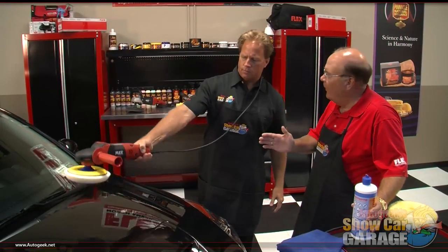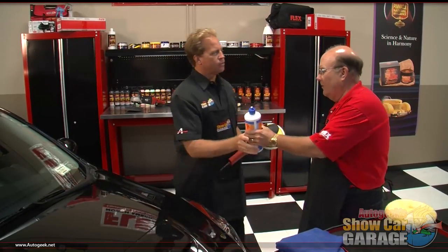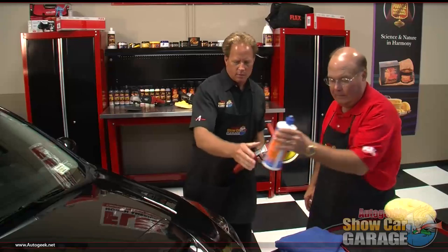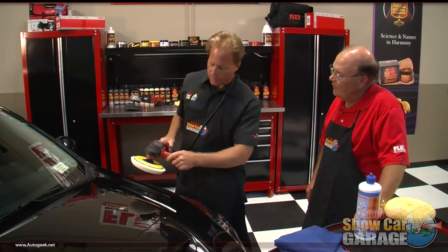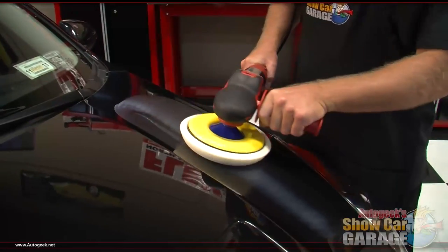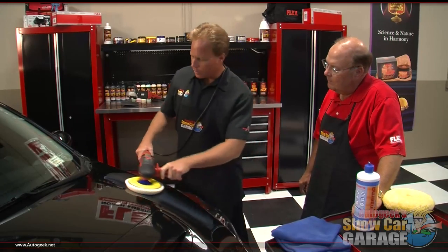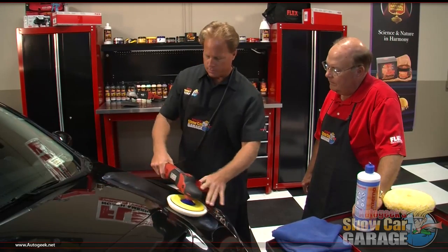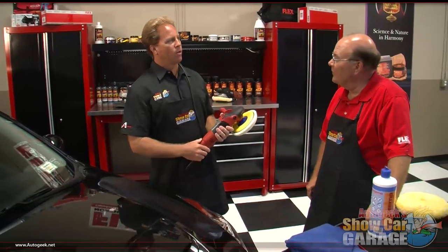Very powerful — this is a professional polisher. Just because the weight isn't there doesn't mean it's not professional. I'm going to lay down a little strip of product here using a technique called picking up your bead at 10. That's 1,200 RPM — it's not even that noisy. The first thing I notice is when I push down on this, the motor does not bog down. That's important to me. It's real balanced and incredibly easy to control. And very, very quiet — how often can you talk over a buffer while you're using it? Almost never. You can never even have the radio on in the background while buffing a car.